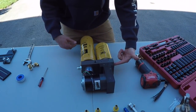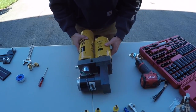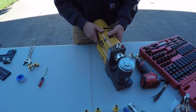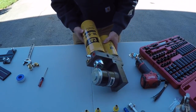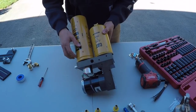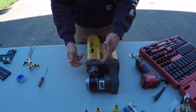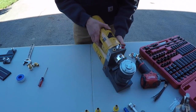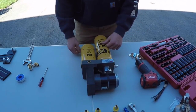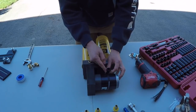Basically what this pump is doing is taking fuel in and pushing fuel out, and you're going to have extra so you have a return. This port right there — the T — that's your fuel coming in from the tank. Right up top here, that's going to be your outlet, so that goes to the engine. Whatever it doesn't use comes out as a return right there and goes back into the tank. Now you're going to see extra ports — those H-labeled ports are for if you want to run coolant through here in a cold weather application to warm your fuel up. And then another port here and here — those are if you want to put electronic probes in there to warm the fuel up that way. So those are for cold weather applications, not really much to worry about. Other than those, you've got the wiring harness connector — just plug and play, pretty simple.